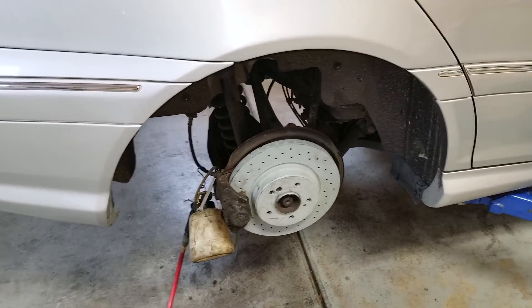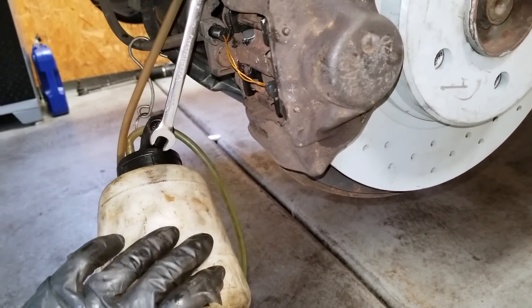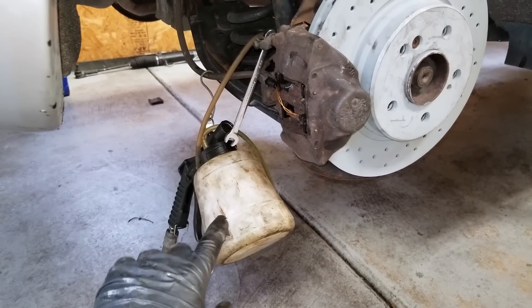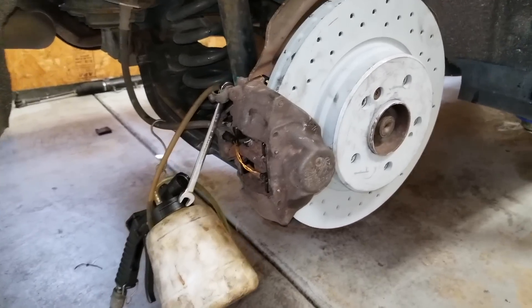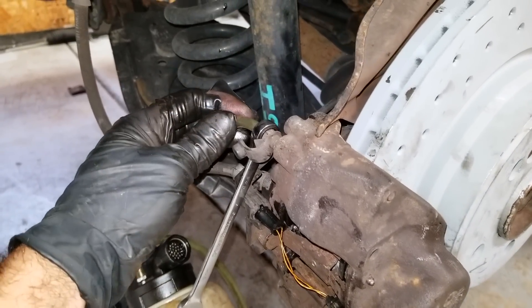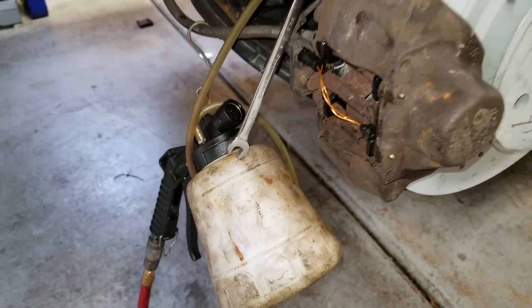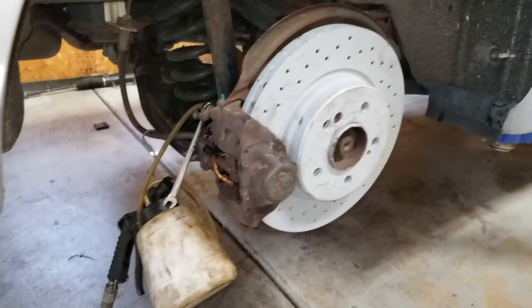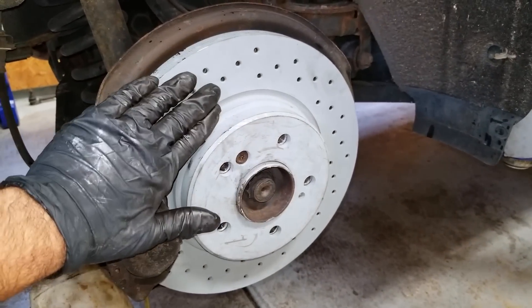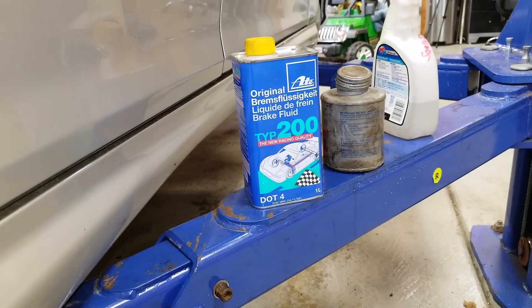Check this out — with drilled rotors in the front and the rear it looks so much better and just makes sense. Right now I'm wrapping things up with a brake fluid flush. The stuff in the system was pretty nasty — you can see in the tube it's all green and disgusting. I'm using my pneumatic sucker to bleed out the brakes; it's really cheap and I'll leave a link below. You do need shop air, but they have a manual version as well. You put the tube to the back side of the bleeder, hit the trigger, and start sucking out all of the nasty brake fluid. Leave the coating on the rotor — let the brake pad clean it off where it needs to be.